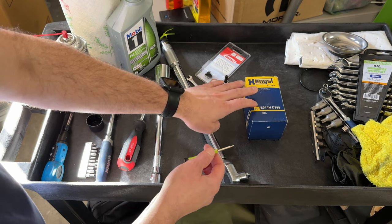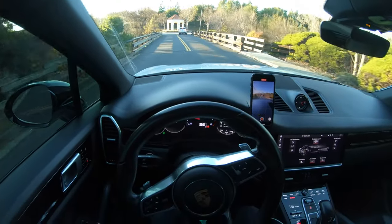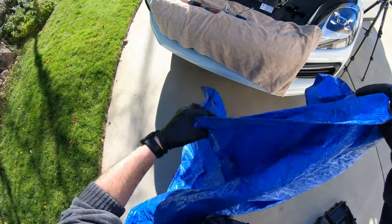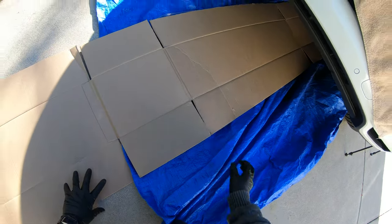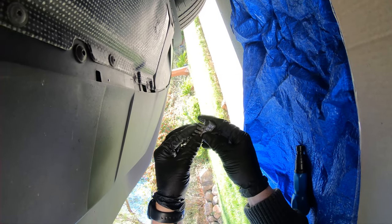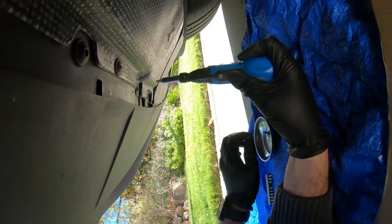One of the first things you're going to want to do is go on a short drive with your car and warm up the oil — this makes it come out quicker and makes the whole process easier. With the engine oil now warm, lay down some protective coverings for your driveway and a long piece of cardboard so you can slide under the car and remove the belly panel. If you have air suspension you can lift up the car for better access, or use something like a Rhino Ramp. I was able to slide under the car and still access everything without lifting the car up at all.